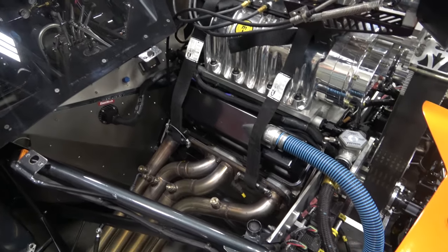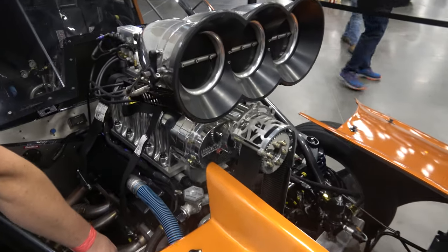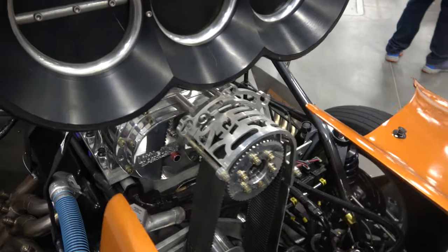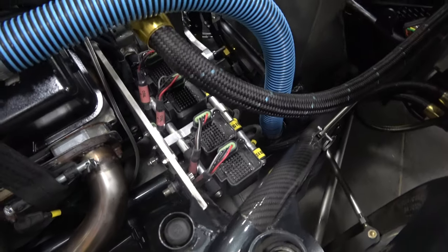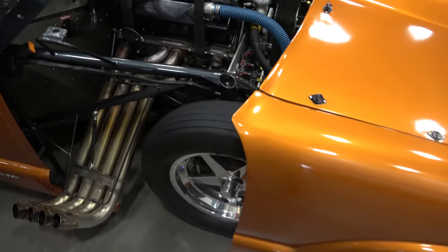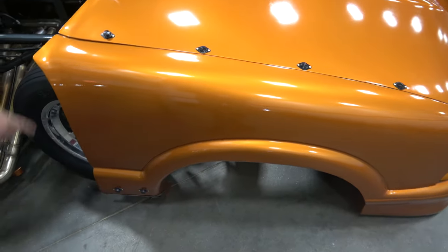Everything's O-ringed intake manifold. It's the only one like that in the world. Wow. This thing is completely EFI, starts like a regular car, runs on 8 coil pack smart coils off a Mercury Marine outboard. It's all controlled through the Fuel Tech computer. Pretty much the truck runs itself. It's got an external electric water pump mounted on the radiator, which you can see there on the front.